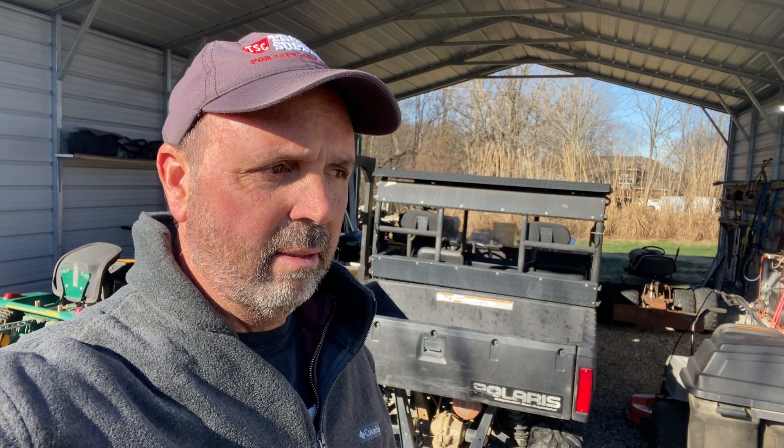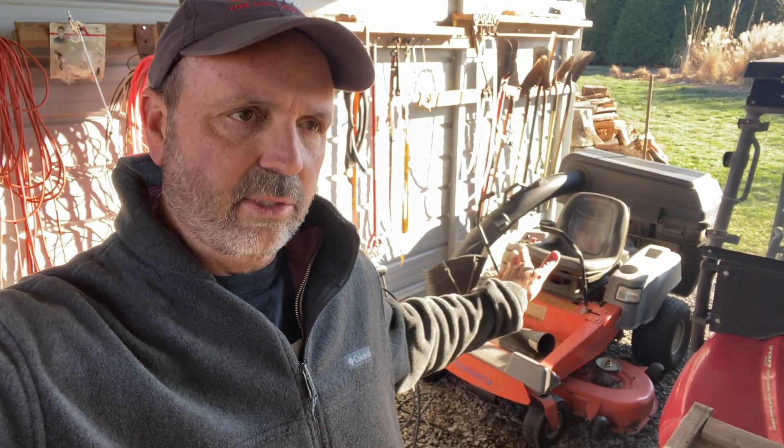And like I say, this is where I'd like for you to comment and tell me your thoughts, because I'm not a mechanic. But I'm going to tell you my 15-year experience. This zero-turn mower right behind me — a residential Husqvarna I've mowed my grass with — I bought it brand new in either 2007 or 2008, so it's around 14 or 15 years old. That whole entire time it has always had 10% ethanol in it. I've never put 100% gas in it and never had to clean the carburetor after 15 years. I do regular maintenance — change the fuel filter and all that — but I never had to clean the carburetor because it just didn't need it.